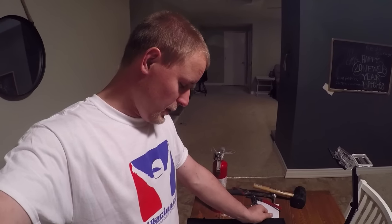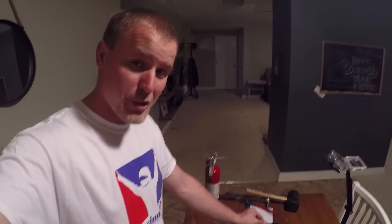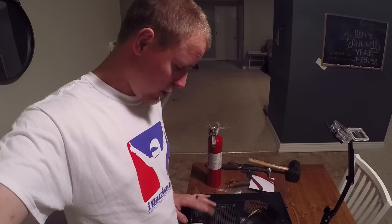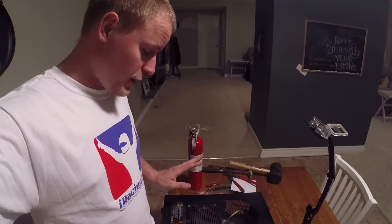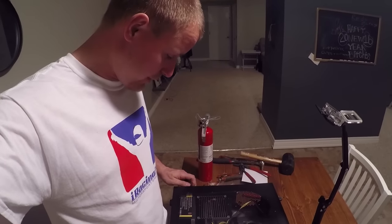I'm back. Progress has been made. It turns on now, but nothing to the displays. I noticed the graphics card is not turning on by the fans not spinning on the graphics card. So, re-examine the graphics card, see where I messed that one up, and hopefully that is it. Hopefully.